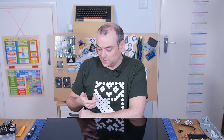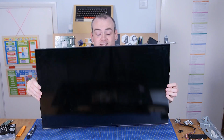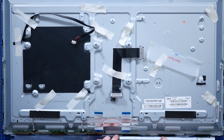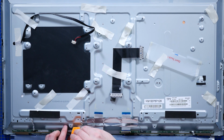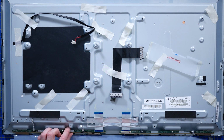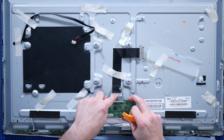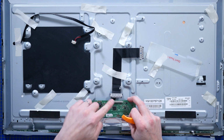So I've now got to flip this over, lay it down very, very gently, and try and prise off those breakout boards before I can separate the display from the backlight. I'm calling these the breakout boards because they don't appear to have any intelligence about them other than some decoupling capacitors, things like that. This board was the driver. This actually actively splits the probably eDisplay port or iDisplay port into its driving hardware.